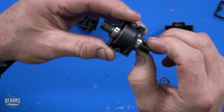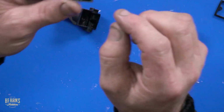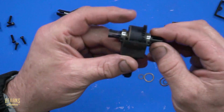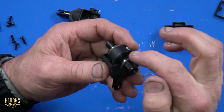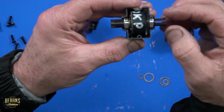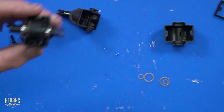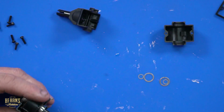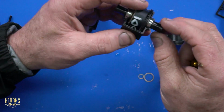What are we thinking, Doctor? What I can see here is the crown wheel. This is something you've got to be really, really crucial on. It's kind of hard to see, but if you haven't tightened these 4 screws up, you'll see it, Brett. You can see how it walks. The crown wheel's got a wave in it. It goes like that. So you've got to check that. What'd you do with the 1.5? Ate it. So you've got to check that. So you just spin it.